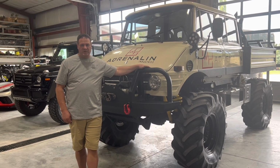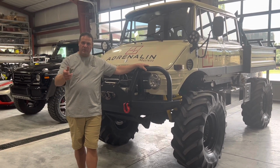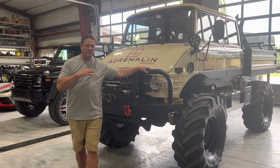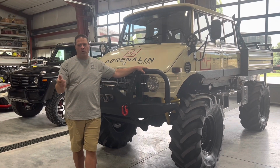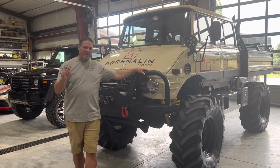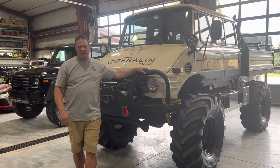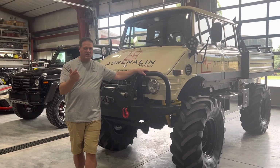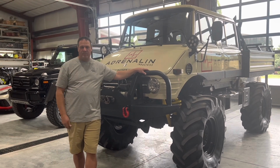It has the 20-speed transmission, which means even on the highway, you've got the splitter gears, so you're always finding the right gear. These standard Unimogs, the 416, 406s, there's a big hole on the highway between your top two gears. So you're kind of wringing its neck in 5th gear, you shift into 6th gear going up a slight hill, up a canyon or something, and it falls on its face. You're back into 5th gear, wringing its neck. So with the 20-speed transmission, you've got the splitter gear, so you can always find that perfect gear.